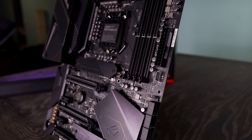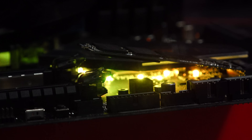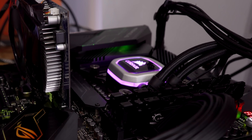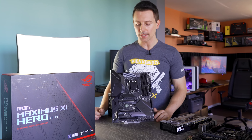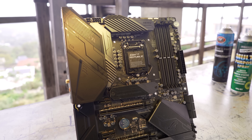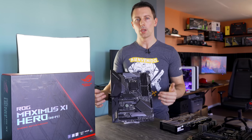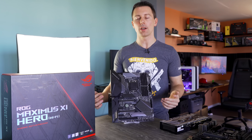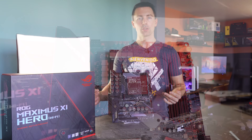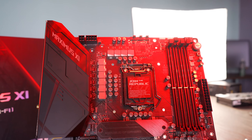Glancing further down the board, you've got the ROG heatsink implementation, which can be controlled with the Aura software, and you can even control it in the BIOS itself, setting different modes if you don't wish to install Windows software. The shroud at the top will also glow with RGB lighting, giving you two different zones on the board. There are three PCIe 16X slots, although only the top one is true 16X speed; the one below is 8X and the bottom is 4X. One thing I do have to pick a bone with Z390 in general — not ASUS's fault — is that they've only included one 16X speed slot. I'd like to see CPUs support more lanes and motherboards offer two 16X speed solutions, so you could link up two RTX 2080 Tis in 32X for both graphics cards.